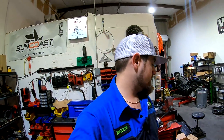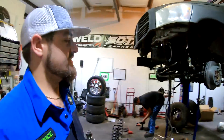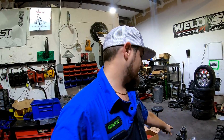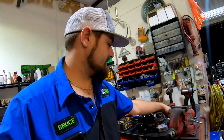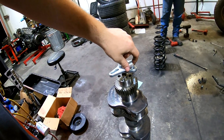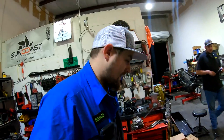The gear is on there very tight and I don't have a puller designed to do that, so we're gonna make something to get this gear off. We also have a factory 12-valve crank with a helical cut gear that we're gonna pull off and hopefully transfer onto this one. Our plan is to take this puller, put it on there, and weld the bolts to the gear. Since we're not using this gear, we're not worried about it — I'm gonna fill those bolt holes up full of weld to get it off.